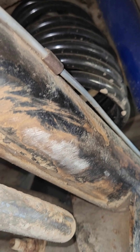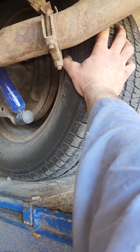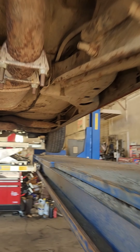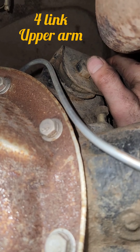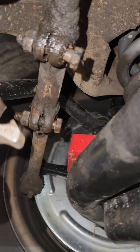They've got some small coils for softening and big coils for bigger loads — a little bit of both worlds. A lot of people forget to look at the back ends of these things when doing alignments, even dealerships. Check your trailing arm bushings like this — rock your tire back and forth and feel for play.